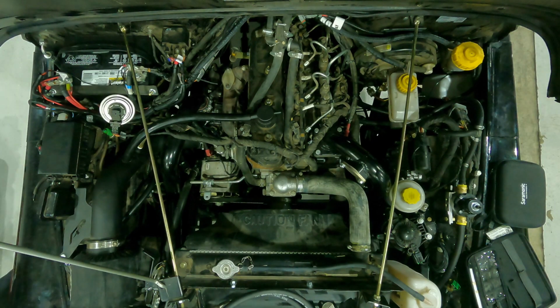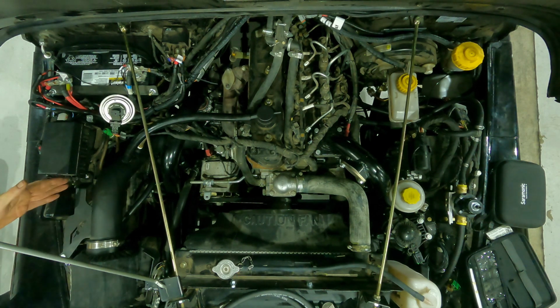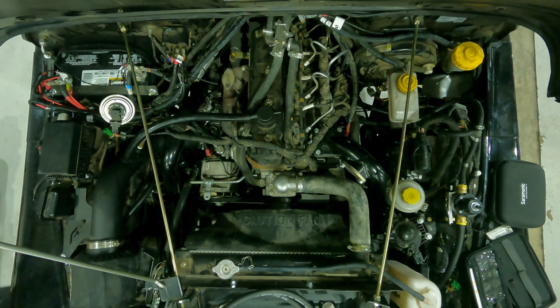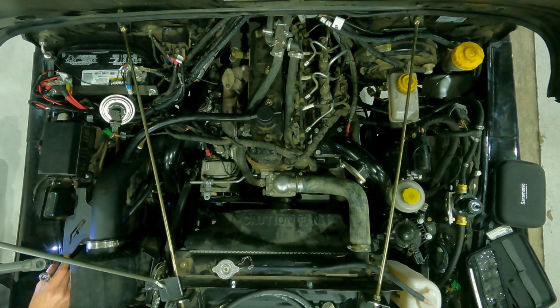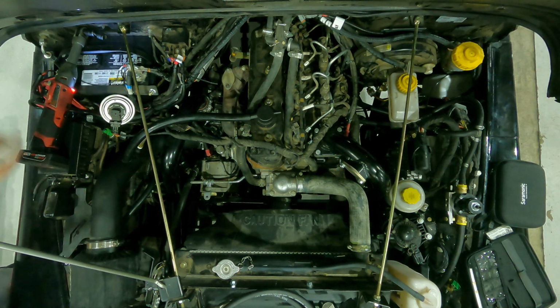What size wrench is on this one? All right, so this one is an aftermarket intake, so it looks like someone had already swapped the bolts around. He's got a 13 mil and a 10 mil. I think the original on these intakes is 2 10 mils. Gotcha. Okay. But yeah, so someone's been in here before, but no problem at all. And then the clamp down on the turbo is a 10 mil as well.